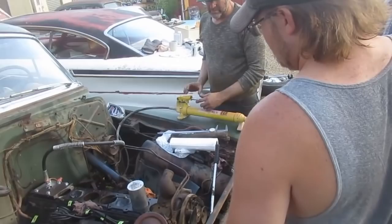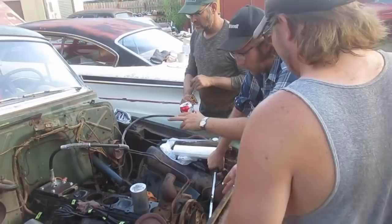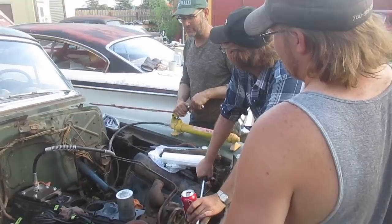We did get this to move like here, and this piston came up. So the crank's turning. I'll feel this. What do you think? Or at least half of it's turning. No, the whole thing has to. Oh yeah, that's right. This moved. Yeah, never mind. We're dealing with some real wicked stick slip. So it's just like bang. That's how it moves 10 thou and goes bang.